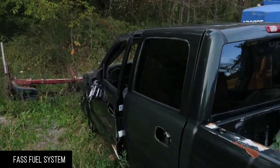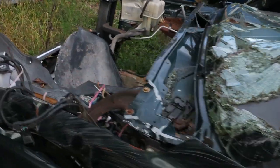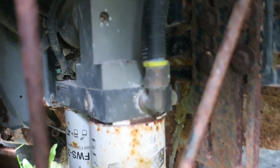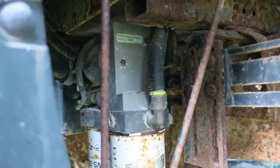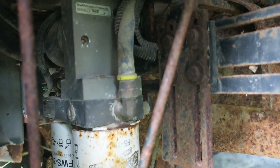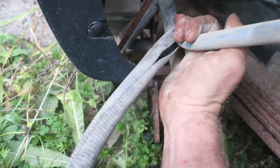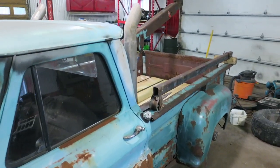Tuesley dropped off this truck a while ago — it's pretty stripped already. I mainly asked for the steering components, a lot of which are already missing. We'll pop that off with an 18mm bolt. These fittings are junk — the fuel line looks like garden hose. We'll put some nicer new fuel lines on there, take some of the wiring harness, and throw it on the C10.